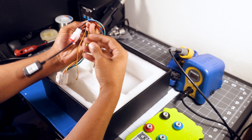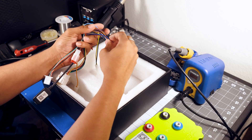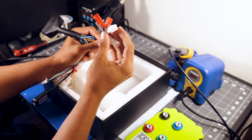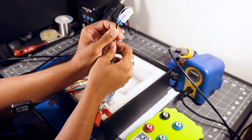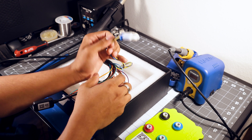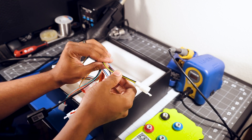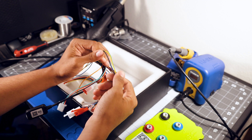You have your Bluetooth module like I just discussed. This three-prong connector will be your throttle connector. I have these next ones tied up because I'm not going to be using them, but they are: reverse, alarm, lock, and the display line — I'm not going to be using a display. There is also the high brake line. Then you'll have your three-speed switch — if you plug in this little jumper it's going to be high speed by default, or you can plug it into an actual three-speed switch to have three speeds. You can also program the software to just pick one speed by default. Finally, this is going to be the low brake — I'm going to connect this to the front brake so that when I pull the front brake it engine brakes, but I still have no engine cut-off on my back brake for wheelies.